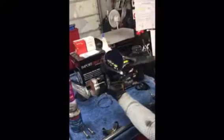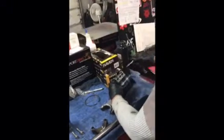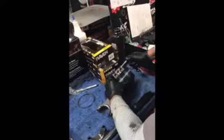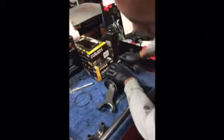And then here is the ring compressor. I put oil in here, lap it around. When you're putting this in, make sure your ring gaps are in the right place. You set it inside. We tighten this, and this will compress all those rings so they're ready to go into the hole. So that just compressed it all.